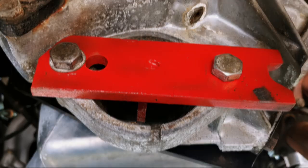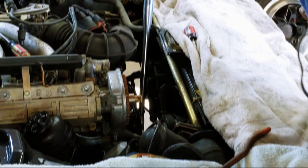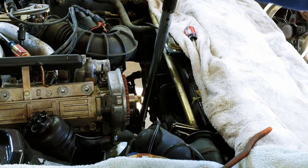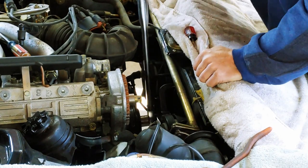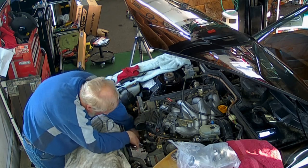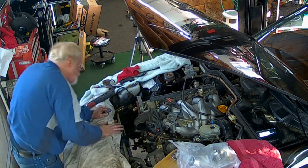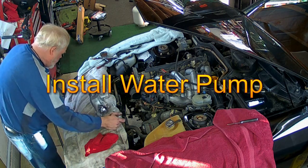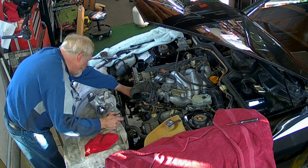With the crankshaft locked in place, I began disassembly. The crankshaft bolt needs to come off — with the lock in place, it's just a matter of leverage. It's 155 foot-pounds of torque. After pulling it all apart, including the belts, the rollers, the back cover, and the water pump — be careful on those water pump bolts. They can be corroded and break off, causing much pain. I got lucky on that one.